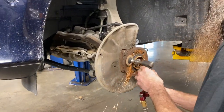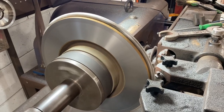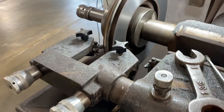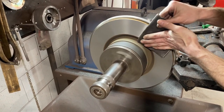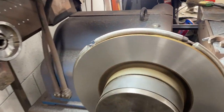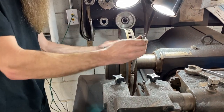You want to clean the hub surface of the vehicle as well. Now there are some cons to machining rotors — when you remove material from the rotor it makes it harder for it to dissipate heat. So if you're using your vehicle for towing, taking it to the track, or you're generally hard on your brakes, I would recommend replacing your rotors over machining them. Once the second cut is finished we're going to use some sandpaper to scuff it up and give it some nice cross-hatches, just like it comes from the factory. Now we can remove it from the lathe — look at that nice finish. This process takes about five to six minutes per cut and it usually costs around $180 in labor, where one rotor could easily cost that much money, so there is definitely a cost savings when machining rotors over replacing them.